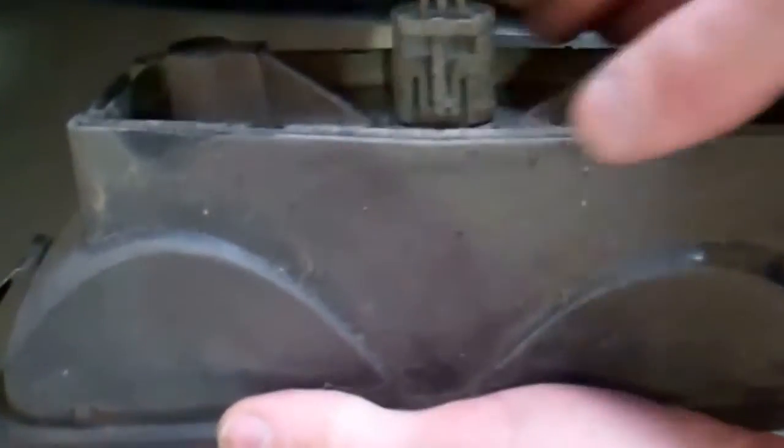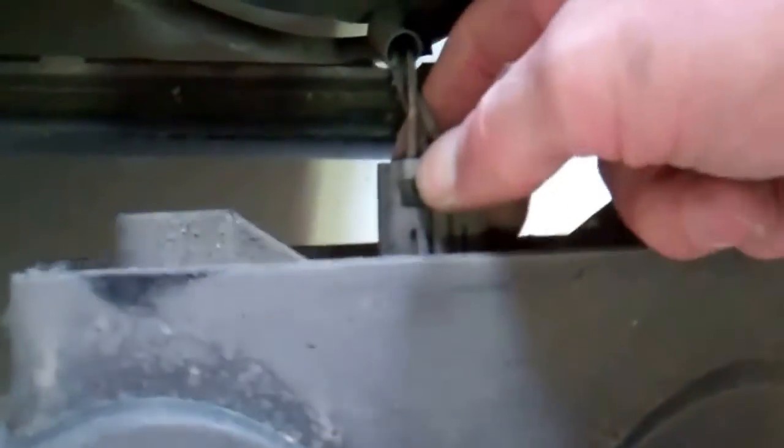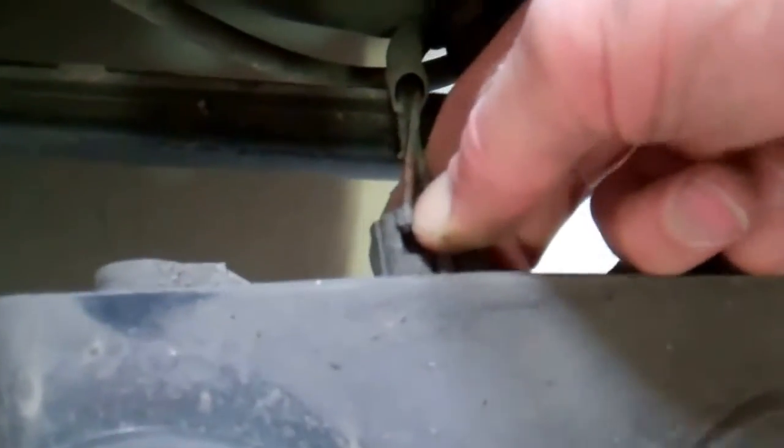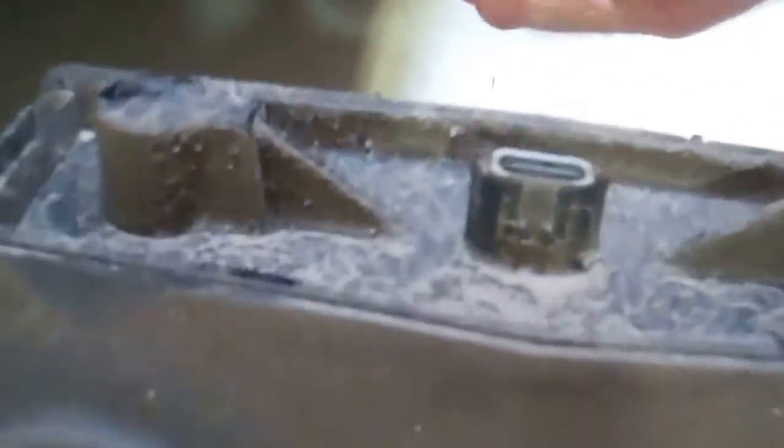So if you look down here — all I did was put my hand up underneath and push this spring clip in, which allowed me to pop the lamp out. Okay, now on the top here you've got one of these fittings. You need to push in the middle here, squeeze that, and that will release the grip of the connector — it's a tight one.